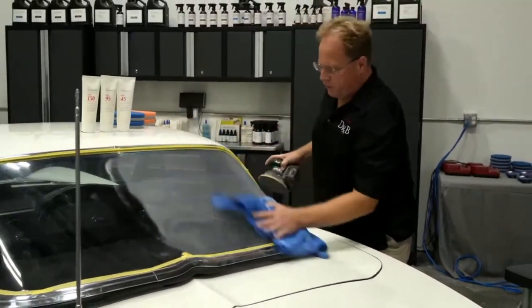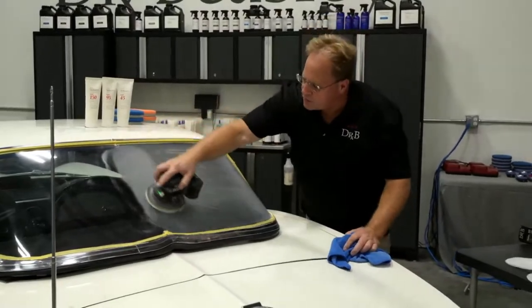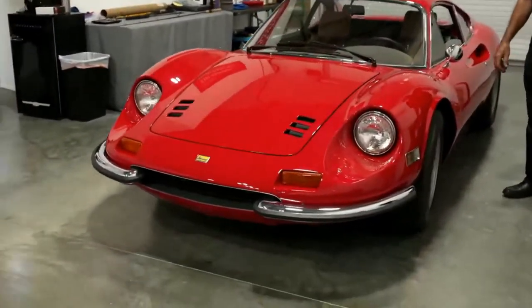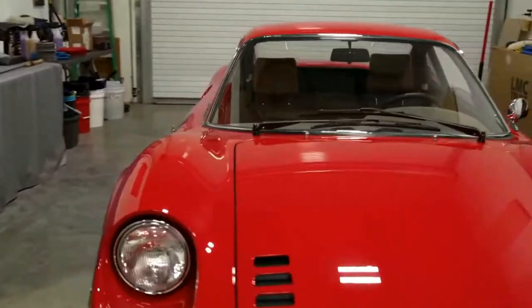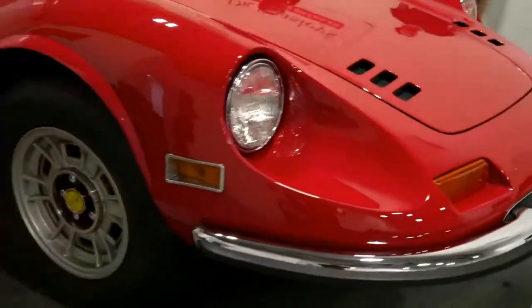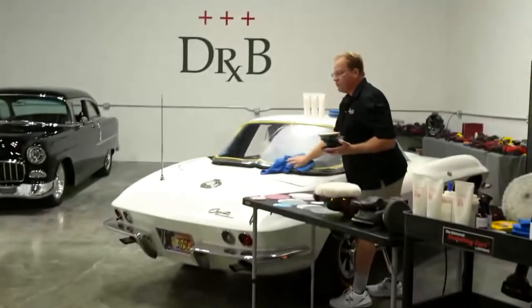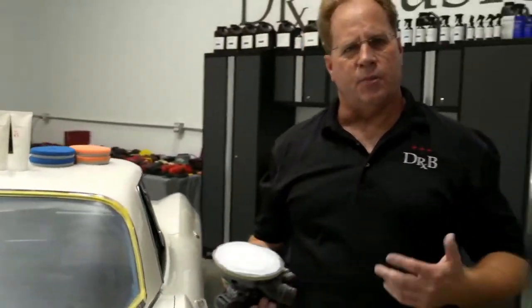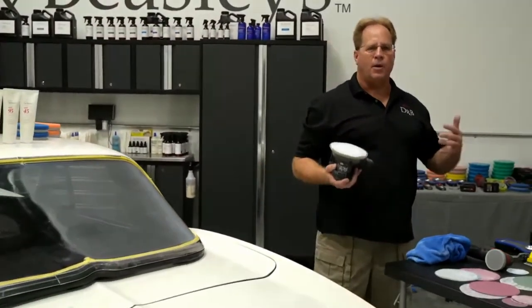As you can see, we're filming live right now, but what just pulled in is a 1973 246 Dino, and my good friend Greg is asking me to do what I call a scuff and buff. A scuff and buff is kind of like a sand job, but you're just going to use high grit like 3000 to kind of schmoo over the surface and remove any dieback. Those are technical terms, schmoo. And then, of course, buffing it and getting it all prepped for show.